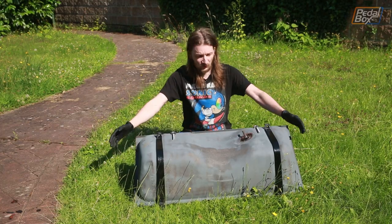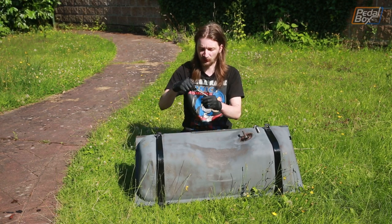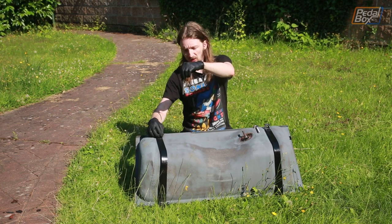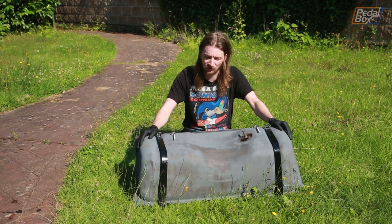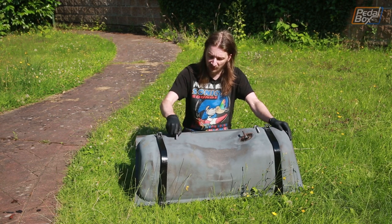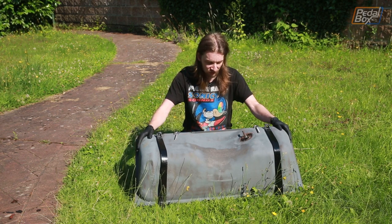In front of me here we've got our nicely refurbished fuel tank, refurbished tank straps, and brand new shiny metric M10 fastening hooks. These are what hook into a couple of tabs underneath the body and the straps fit over them, with a little nut that holds the whole thing in place. Unfortunately we're doing the most cursed thing possible and putting metric fasteners on the back of this car — hands are a bit tied, it's tricky to get these things in imperial just round the corner from us on these timescales. But with how rarely these fuel tanks come out, it's probably not a huge deal.